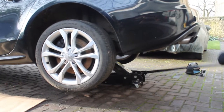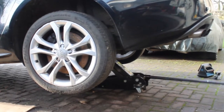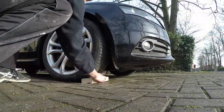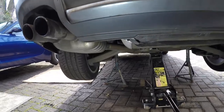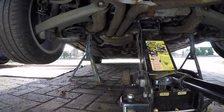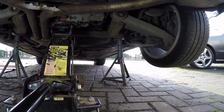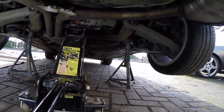The exhaust sleeves are usually located under the middle of the car or towards the rear, so when doing a job like this I usually jack up the back of the car. I start by placing wooden chocks in front of the front wheels, then jack on the diff, and finally place the axle stands under the rear suspension arms. If you're unsure how to do this, I recommend you check out some videos — I'll provide a link in the description if I produce one.